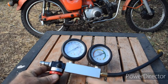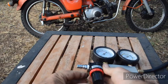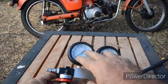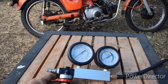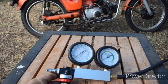I had to change the barb fitting, and the original had a Schrader valve in the end. I didn't think that would make much difference, and today I made up a barb with a Schrader valve fitted — and it makes no difference whatsoever. As we wound up the gauges, both went up in sync, exactly the same, which doesn't seem right. As the leakage gauge drops, they're both dropping at exactly the same rate — there's no pressure difference being recorded. So really this tester is virtually useless; you can't rely on this gauge to give you a correct reading. It just doesn't work as it should.